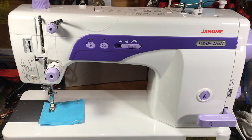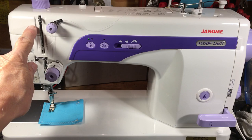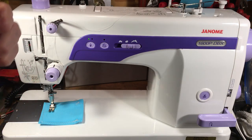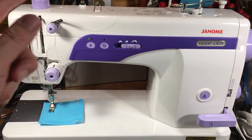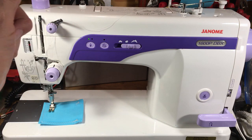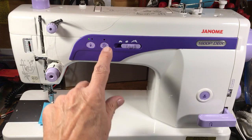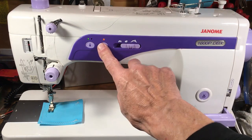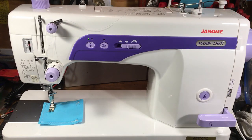This machine has sealed bearings and doesn't require a lot of oil on the top or bottom main bearings, but inside where the take-ups and other parts are, it does need oiling and the top cover has to come off. Of course you have to unplug the electric bobbin winder first. When you put it back together, make sure you remember to reinstall the bobbin winder connector into the motherboard, otherwise it won't work. Always check and test it before sending it back to the customer.